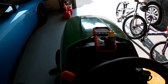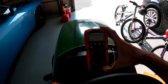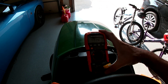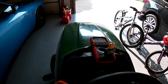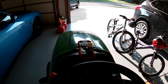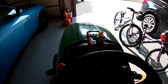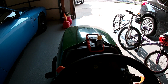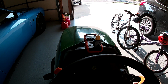Okay, so it's about a week later and it's quite a bit cooler today. I'm going to run my second test. We've got 71.4°F — I think I was closer to 80 on my first round. That's okay; I can correct for ambient temperature by simply finding the delta between the two days and adding the difference. So I'll go ahead and get started. This time around, when I'm done, I'm going to let it idle at low idle, parked in the garage for a couple minutes, and see how that affects the shutdown temperature.